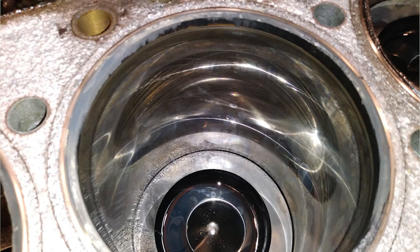This gets us back to discussing the importance of the temperature range. What is that temperature range? For coolant temperature, that's generally about 200 to 220 degrees Fahrenheit — around 100 degrees centigrade. Engine oil temperature is always a little bit higher, usually running 210 up to maybe 250 at the higher end of the range, but you don't want to get much past that or the oil can start breaking down. The reason you want that temperature range higher is because the engine is much more efficient at that range. The piston and cylinder wall are much closer together but not touching, all the parts are at a uniform temperature, and the cylinder temperature being slightly elevated will help fuel atomize and prevent cylinder glazing.